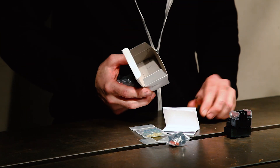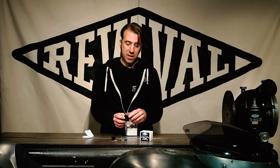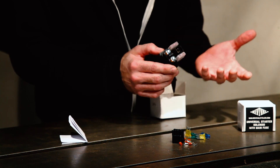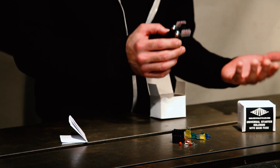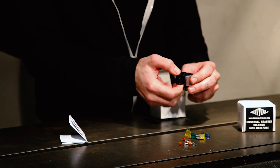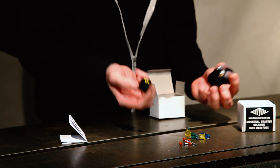And then a couple of mounting brackets. This new solenoid is slightly smaller in form factor, so it's a little bit easier to package, and it has a nice cap that covers up your main fuses, helping to keep moisture and debris out of there. This was just a nice simple package that we felt was a little bit of an upgrade, a little bit of a modernization to the old one, and the big driver for that is this connector is a lot better than the old one. The amount of force required to seat it is less, the amount of force required to remove it is less, and it's waterproof.